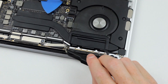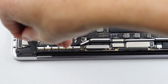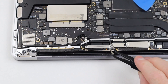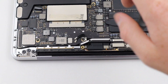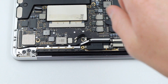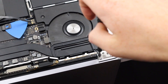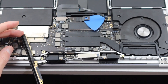There is a variety of Torx and Apple's own Pentalobe bit throughout the repair. Compared to previous generations of MacBook Pro, I found this device much more difficult to repair. One upside to this USB-C non-touchbar MacBook Pro is that it has a replaceable SSD drive, which is not found in the touchbar models. SSDs only have a certain number of read and write cycles and eventually wear out, but with the newer touchbar MacBook Pros, the SSDs are all soldered to the logic board, meaning replacement requires complex micro soldering.